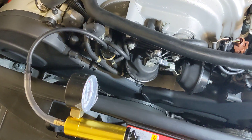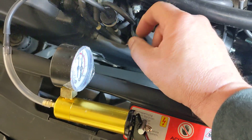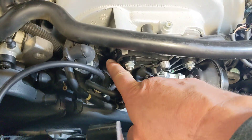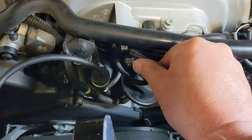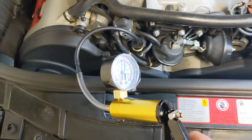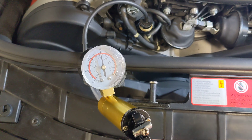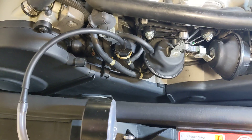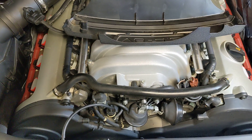I thought there must be another leak in the vacuum lines. So I went right here on this check valve — this hose normally goes here and runs right into the intake manifold right beyond my finger. What I assumed I could do, and was successful, was pull a vacuum right from here using a hand vacuum pump. This has been on here for every bit of 15 minutes, and it's holding rock steady at 15 — whatever the metric is, not PSI, but 15 vacuum. It seems to be holding, yet I'm still getting the insufficient airflow error.